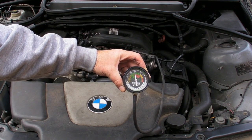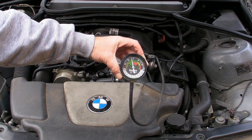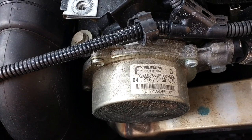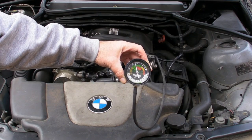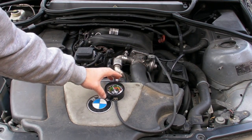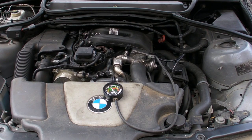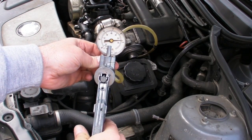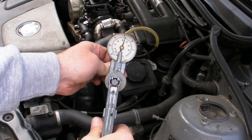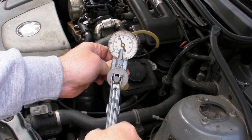So you can see there that it's the vacuum pump, I'll put a picture in, because a diesel engine doesn't create its own vacuum, and it's supplying that vacuum to the EGR valve, and that's getting pulled in. You can actually hear the engine when it's getting pulled, the revs die a little bit. So the other way of testing this valve is to just simply put a vacuum pump on it, disconnect the normal vacuum line and draw a vacuum in.